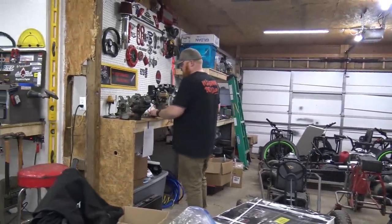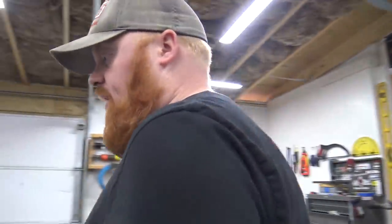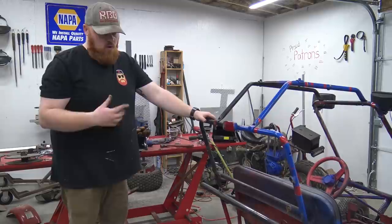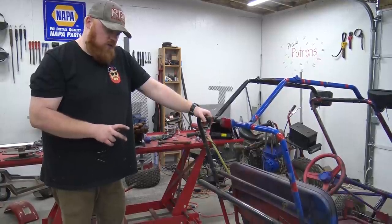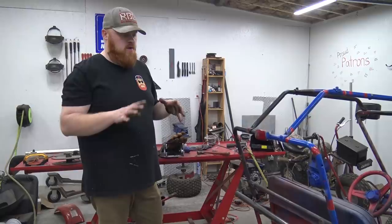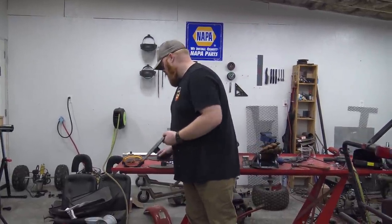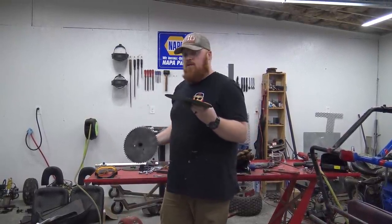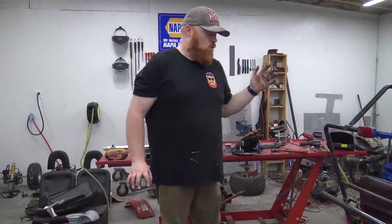Links will be in the description below for where you can get these Springer spindles. I like to buy the non-Springer ones because they're shorter and tend to work better in my applications. We've got to get this lined up and pushed up to those brackets, then tack it in place, unbolt it, and fully weld everything off the go-kart. I was going to go with 54-tooth sprockets, but look what I found — a couple of used 60-tooths I didn't know I had. This is going to come in super handy because it will give us the torque we wanted — stupid torque on this thing.